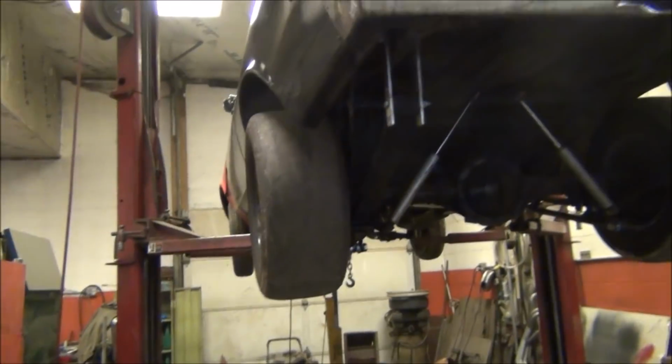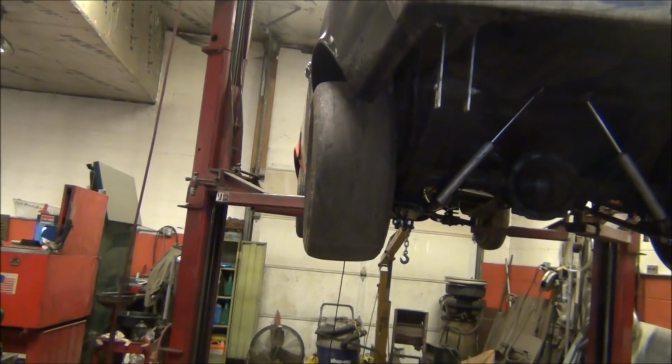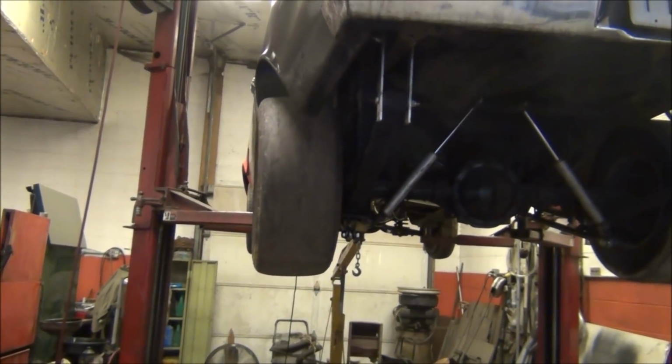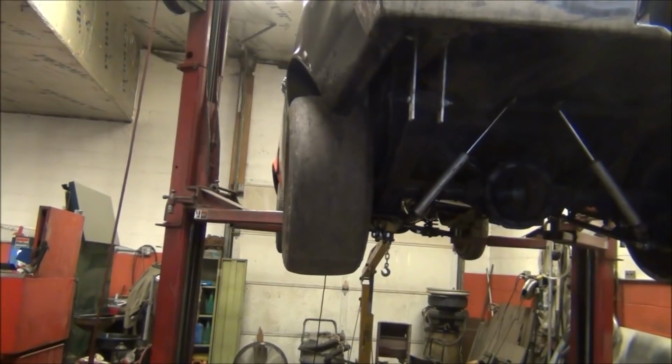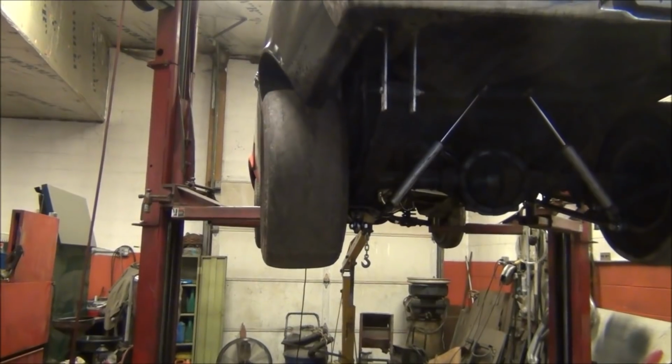And sooner or later, it's going to kill one of them roller lifters. It ain't if, but when, because no matter what, it will hurt them sooner or later, because with all that spring pressure, they're slamming up and down them lobes. Solid rollers are hard on street cars. So I'm going with a hydraulic roller, and I'm turning this motor right now like maybe 65, 66. The new cam's going to make power to 62, so it'll be perfectly fine. It'll give me some more bottom end.